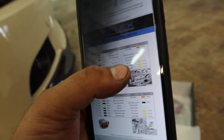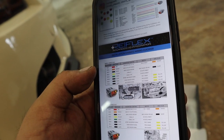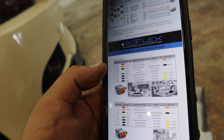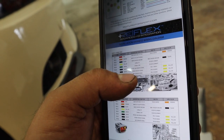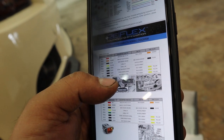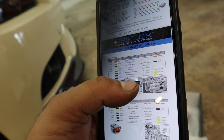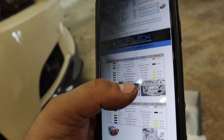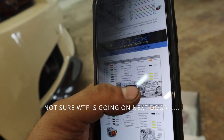CAN is listed as 'in development' so we're not worried about that. What we need are the intake cam sensor, crank sensor, and MAP sensor. For those: pin 2 is power, pin 11 is intake cam sensor, pin 29 is crank sensor, and pin 10 is MAP sensor.